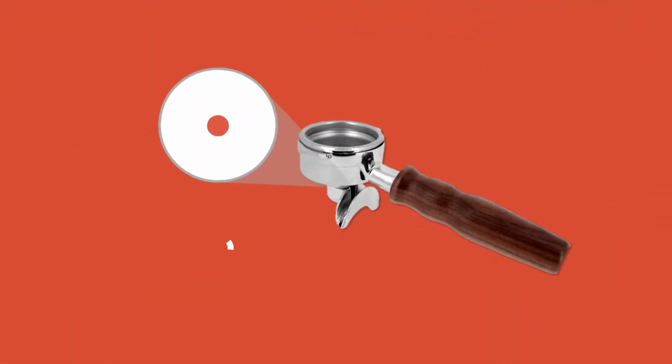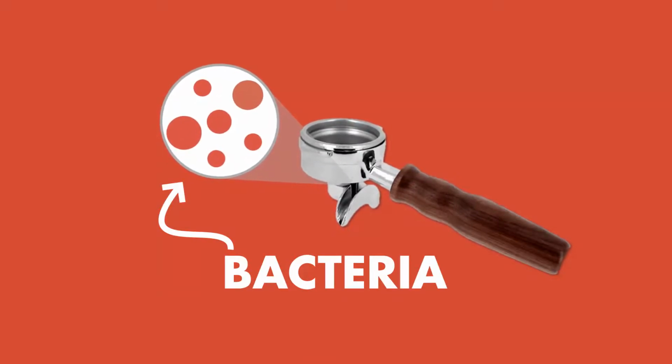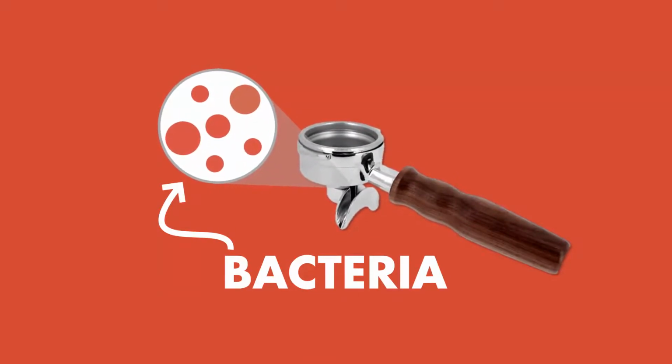Now, you might think, well, I only use my coffee machine once a day, so I don't need to clean it very often. And that's simply not true, because the bacteria in the coffee can actually spread further over an idle machine just because it's hot and it's moist, and it will actually cause bitterness to last there for a longer time. No matter if you're just doing 1 shot per day, make sure you backflush always afterwards.